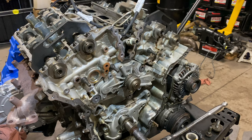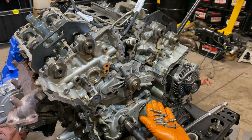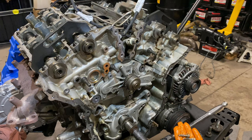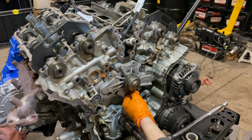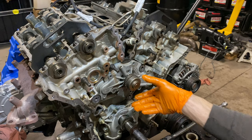A lot of you guys, if this is your first time, be careful — the bolts aren't always the same length on every model. On this particular model they are all the same length and all the same torque, but that's not always the case, so watch out for that stuff.